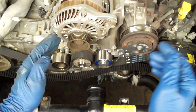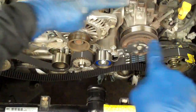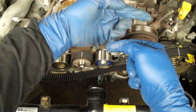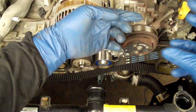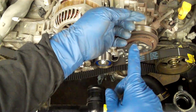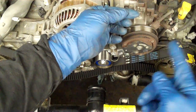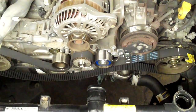So where they are is right in the middle. All of them are even because on this side, when one goes out, the other's in - the pistons exchange this way, and same on the other side. If you have it in the middle, then they're both recessed from the top of the piston - where you'd have to put the piston rings in. They're both as far away at the same time as they can be together at mid-stroke. So if the valves were to open and close, you've got plenty of room. Don't worry about it.